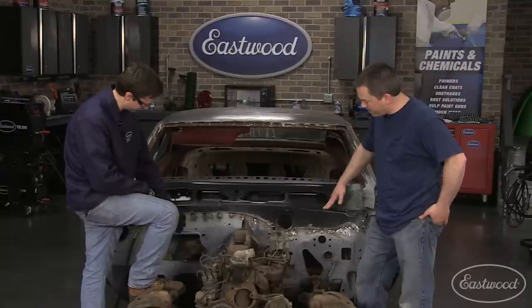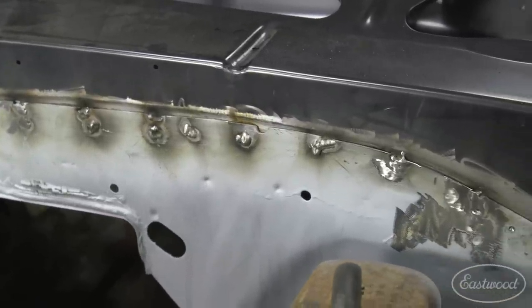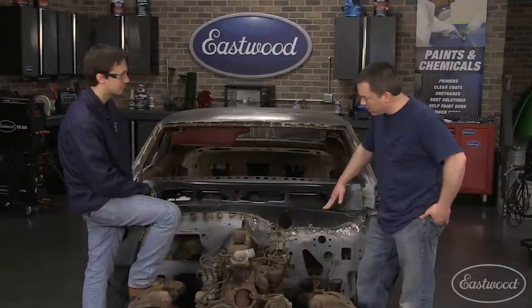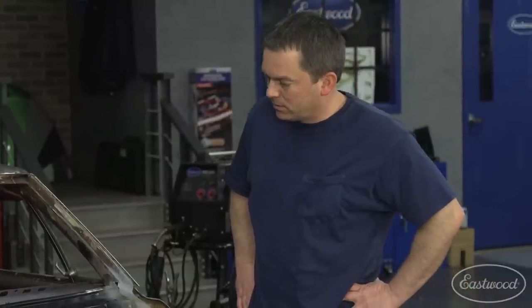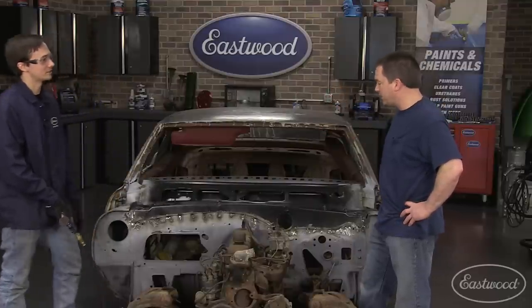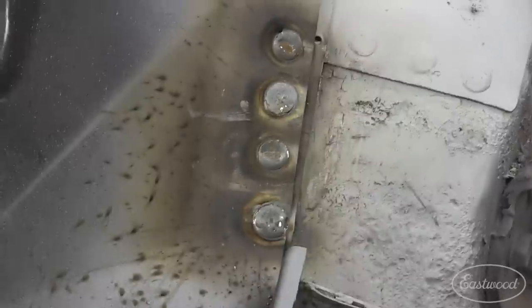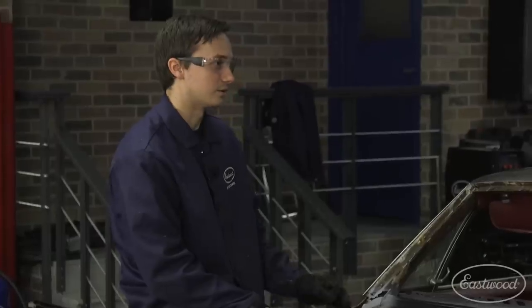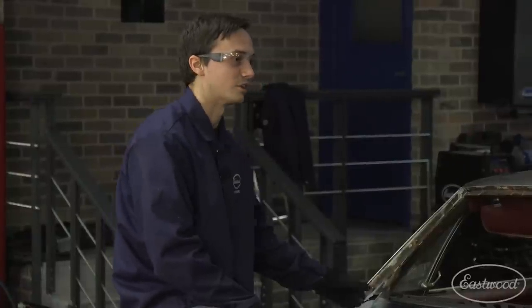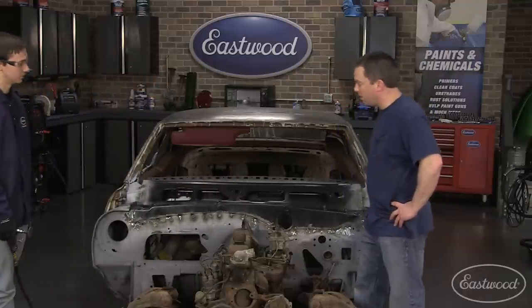So what I'm gonna do is drill in between each spot weld a 3/16 hole and just get in there and do a nice, small, clean looking spot weld. I was able to do a few of them in some other spots. Yeah. That came out pretty good. Ideally it'd be nice to have small hole diameters, but I'm filling the OE spot weld. So I think just taking my time, working in the center and then trying to attach to the side. Go from the center where I got the new metal and then just go over and touch the side of the old metal, rather than try and fill like a true spot weld. Yeah, those are pretty big holes, but the ones you did up here, these look fine. Yeah, that's what I had up there. I did a 3/16 hole and I was able to get down to the base metal and then fill. So I'm gonna do that in between each of the OE spot welds, to give myself some more structure. It'll look a little better.